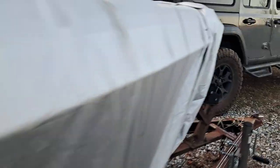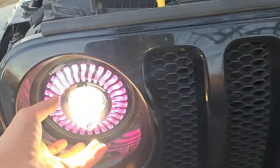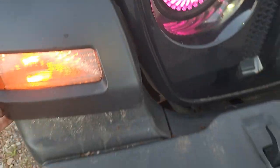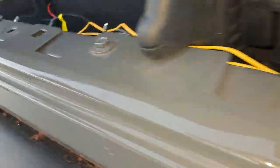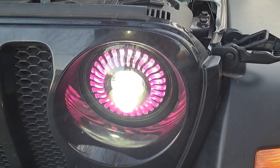So it's got the old 2020 JL, and these are pretty simple — like I said, demon eye halo lights. There are two jumpers so you can plug this light into the stock plug-in. You just splice that yellow wire in over here, run it up through here — this has two connections — and then that yellow wire will just pop together real simple. Same thing with this one, then you run the other one over, peel this back, run it right through here, pop that light out, connect it in and stick it together.